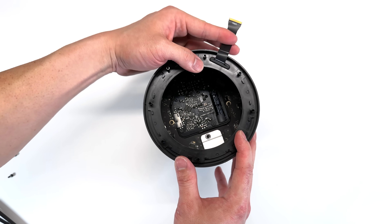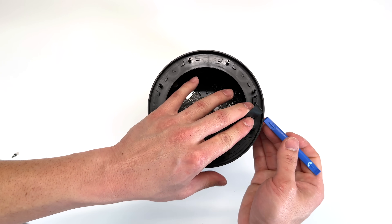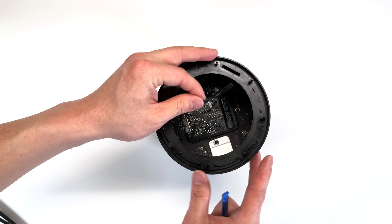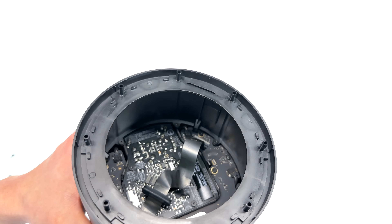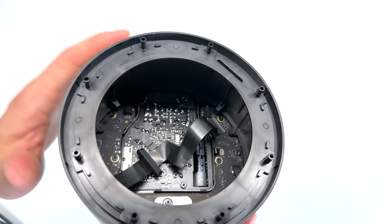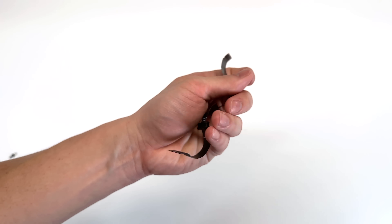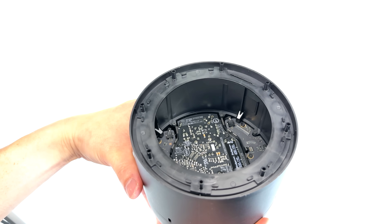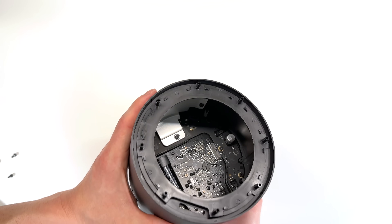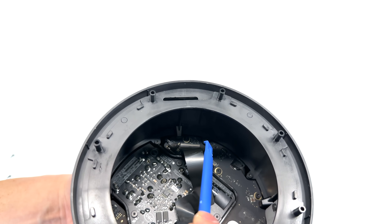Let's take another look at the HomePod. I'm going to push this rubber grommet in with this ribbon cable so that when we take it apart later, we won't damage it. I'll also undo this ribbon cable so you can have a better look at the inside. Just like the other ones, the connector flips up and you can gently remove the ribbon cable. Here's a look inside the HomePod again — there are eight T6 Torx screws located in the rear.